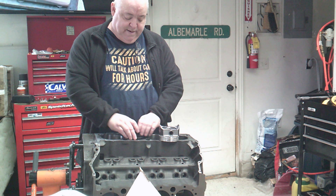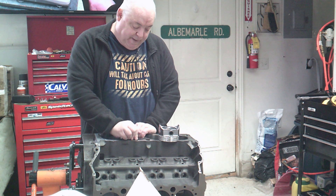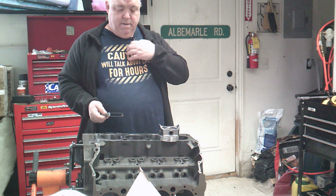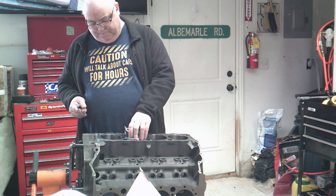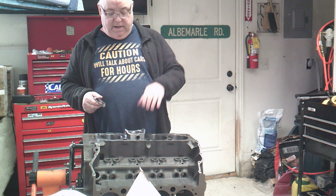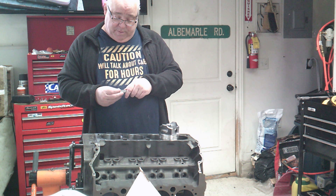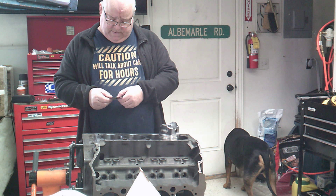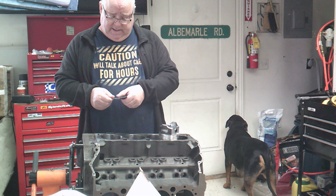So we're definitely going to have to do a little bit of work on them. You just put your ring in the cylinder — and yeah, they're very very tight. You have a little gap in there. Find the gap, then use your piston and push the ring down a little bit so it's nicely centered. You don't want to gap your piston rings with them crooked — definitely push them in a little ways and then check your gap. Being careful not to drop the aluminum piston, these are going to be 28 thou. Going the opposite direction — brand new, they're covered in oil — 24, 25, 26, 28. There's 28 right there.